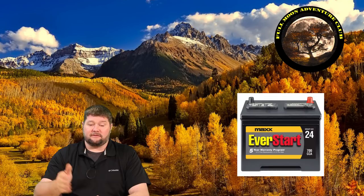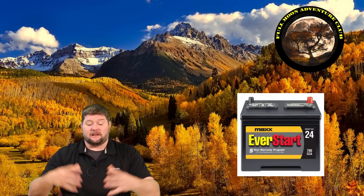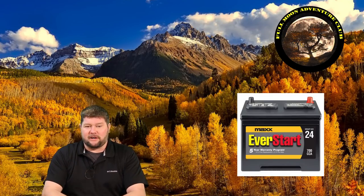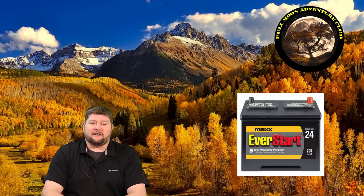The house battery in the back is usually going to be a deep cycle battery, so it's good at slowly releasing energy and then charging up multiple times — usually doesn't have a lot of cranking amps. Then you have your chassis battery under the hood, which starts your engine. That's generally designed for a lot of cranking amps — a lot of power right off the bat to get your engine started — and then it's just supposed to charge up and sit there idly.